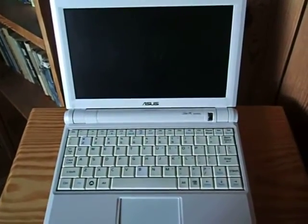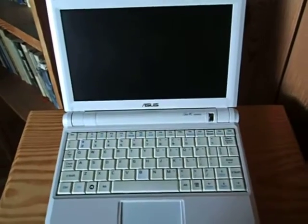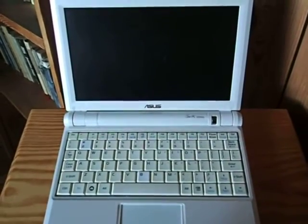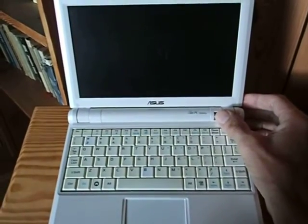Well, one of the best things you can consider doing is turning it into a modern, fast Chromebook. The way you do this is by first loading it up with Lubuntu, a version of Linux, installing Chrome, and then setting up Chrome to run in a mode that's efficient on this little computer.